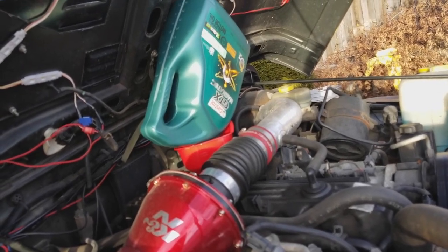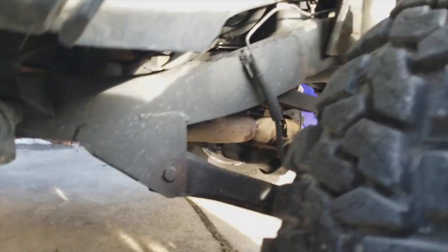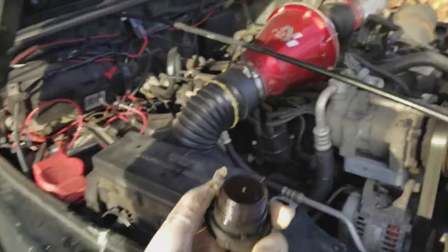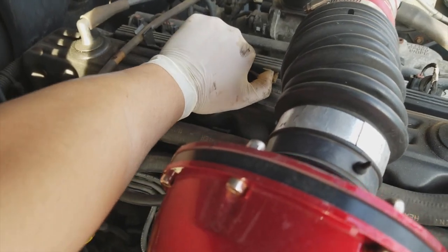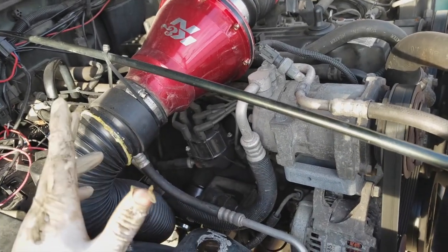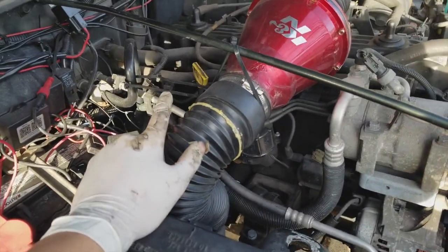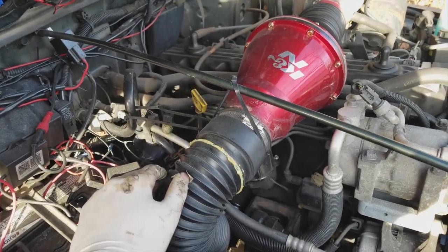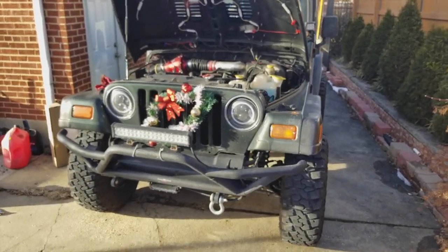Let everything drain from the container into your engine. Before anything, make sure there are no oil leaks underneath — I already checked and there aren't any. After pouring the oil in, clean up the cap with a towel, screw it back in hand tight. Then turn on your car, let the engine idle for about a minute, come back out, check your dipstick, and see if the oil is at the correct level. If it is, you're perfect. If not, you added the wrong amount. That's how you change your oil — pretty simple. Thanks for watching!